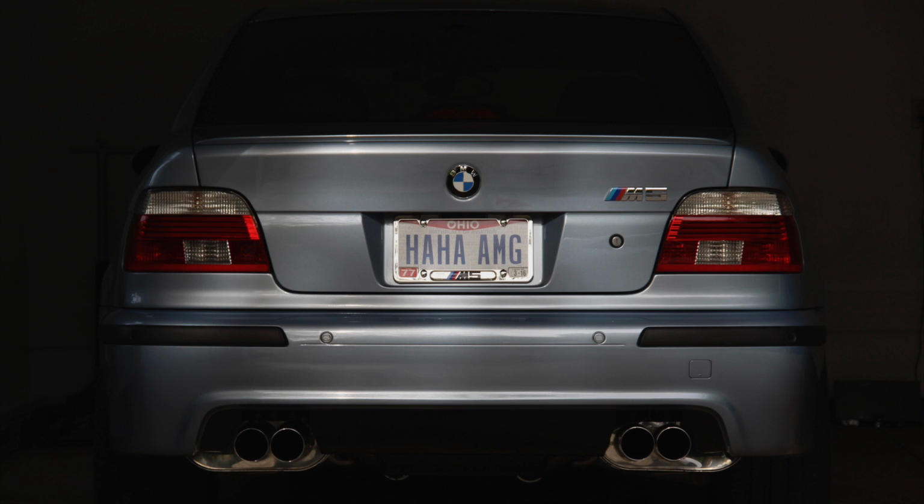And then when I get it back, I'm under pretty strict instructions. Nothing over 3,500 RPM for 500 miles, no highway usage for 500 miles, no heavy throttle, obviously, dumping clutches, that's not happening. So we're just going to have to be gentle with it for a while as the engine does break in. So that'll be a different experience, but it'll be exciting.